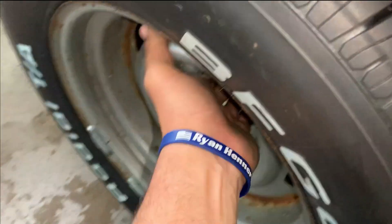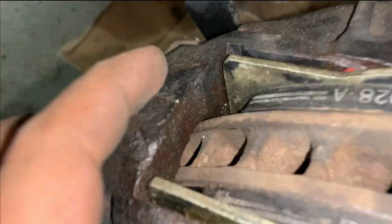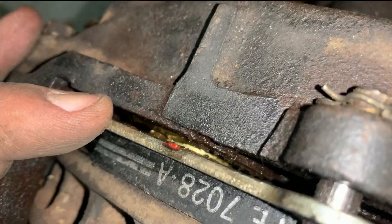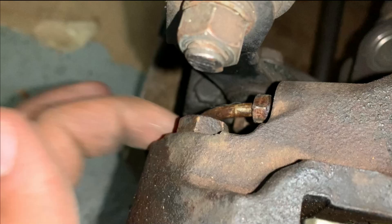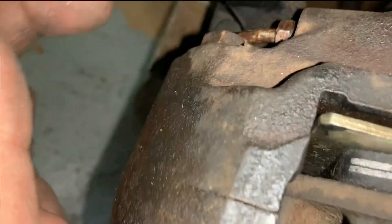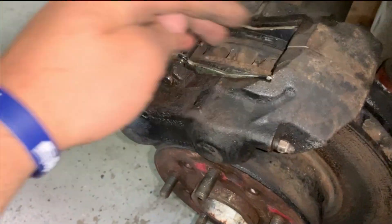All right, let's see what we've got going on here. I can see some brake fluid accumulating in the caliper right here. I think it may be coming out of this cylinder — it's not coming out of the fitting because there's no brake fluid accumulated there. It's mostly coming from where this thing connects together and the actual caliper itself, so let's yank this off and put it on the bench.